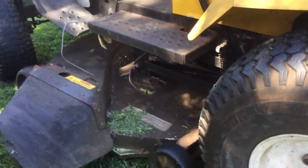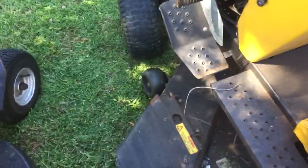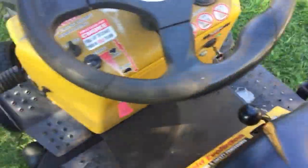This is a cast aluminium deck. There's my little Mini Mow — it's got anti-scalp wheels on all four corners. The blades are absolutely stuffed, as you can see — they're swing-back blades. The deck is thick, but this mower has hit plenty of rocks. It's blown a hole through there — I'd say that's been a blade thrown up into there — but the owner gives it a very hard time.